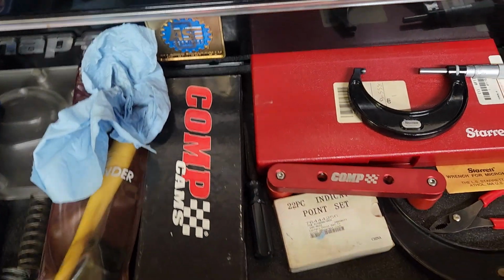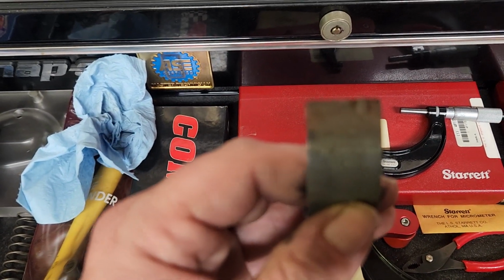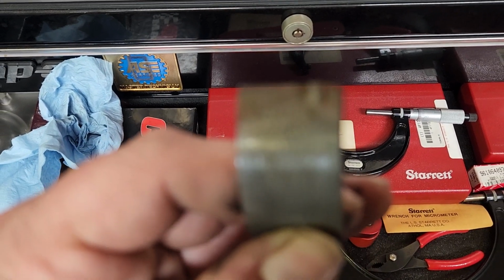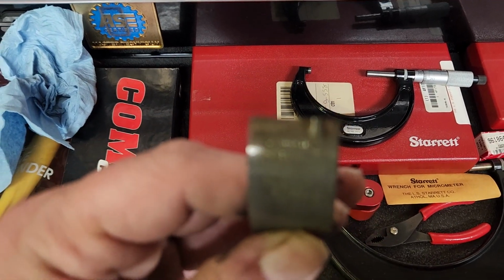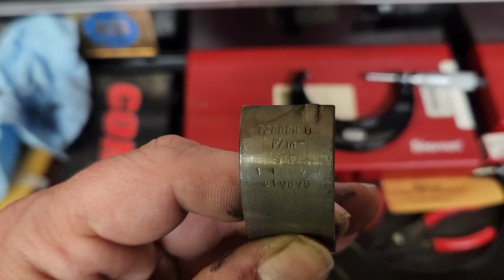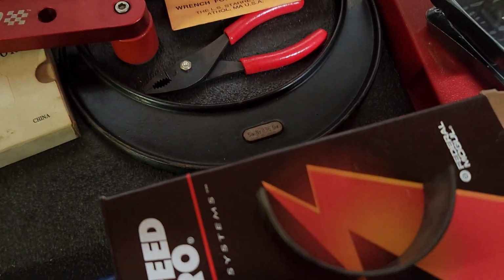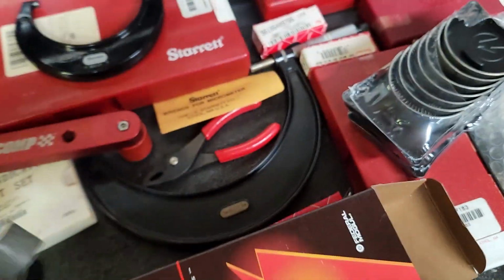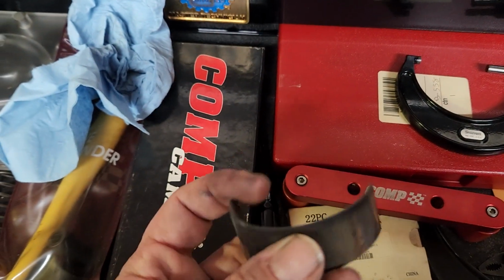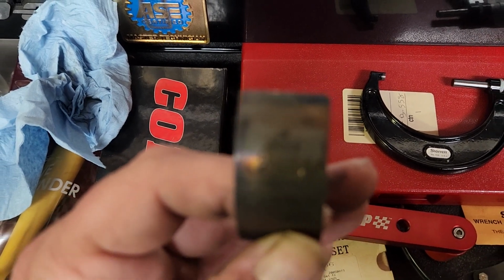All right, so the old bearings are out, and the new bearings, the 1-under bearings, are getting ready to go in. Now, I don't recommend mixing your parts together. But the back of the bearing is marked. If you can see that, the bearing says STD on it. That means it's a standard bearing. So I know that this bearing is one of the ones I just took out, as well as this one here. This one has the same markings on the back. These are my 2 new bearings that are going to go in, and these are the ones we're going to check. If you look at the back of these, get it to come into focus.